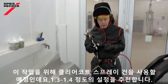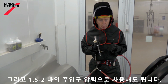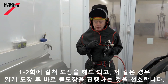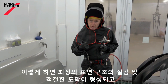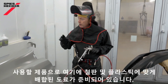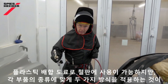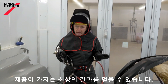For that, I've taken a clear coat spray gun and I would recommend a 1.3 to 1.4 setup, using between 1.5 and 2 bar inlet pressure. For the primer surfacer itself, I have some choices: I can apply it in one to two coats, or alternatively I like to apply a thin coat followed directly by a full coat. This gives me the best surface structure and texture, the right film build, and a very good even surface on which to apply my base coat. I've got metal and plastic-adjusted products here. I can use the plastic mix on metal, but if you have the possibility to do the two-pot method, I would do that — you'll get the best out of the product that way.